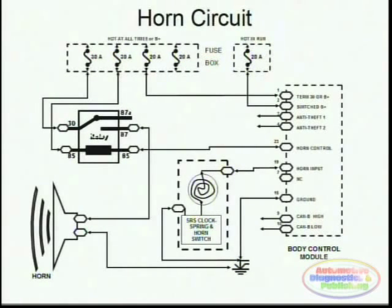In this particular case, we see that this motor is actually fed power or voltage source through a relay, which in itself is controlled by the body control module. This body control module may also serve as the actual anti-theft alarm system, because the anti-theft module is contained many times within the actual body module. The ground is directly tied to the horn itself.